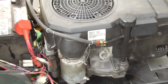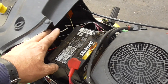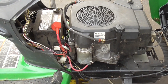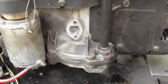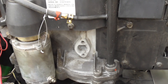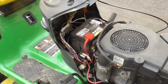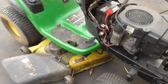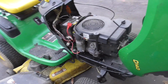It works great because it wasn't pumping fuel before and now it is. My options were to either put a gas tank up top and make it gravity fed, or buy an electric fuel pump for about 40 bucks. I figured I'd give this a shot. Kohler makes one that actually bolts on, but this was free and it's working fantastic. This engine is really strong — I was concerned about going with a single cylinder, but it runs well, the PTO works, and the charging system is working.